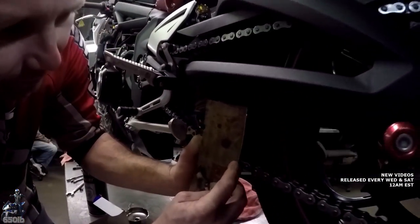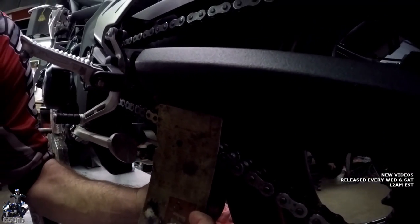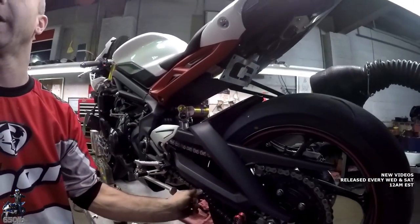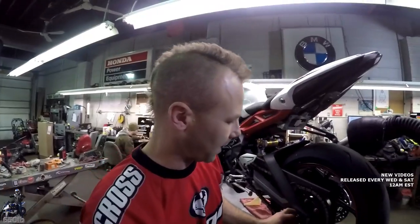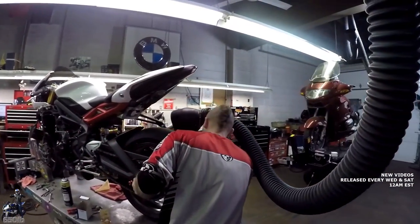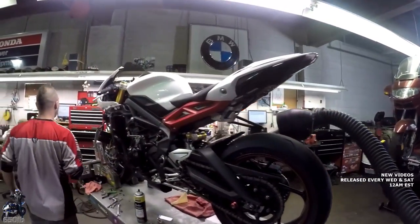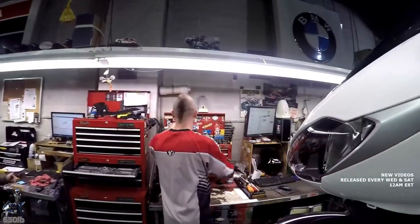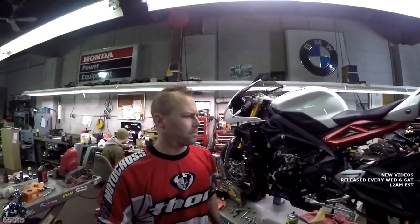I got 75 there and it goes all the way up to 25, so that's 50 millimeters where we're at right now. We've got to cut that in half pretty much. To do that, we're just going to loosen up the axle and move our chain adjusters back. Have I been riding with a super loose chain? You've been riding with a super loose chain.